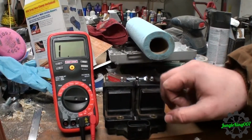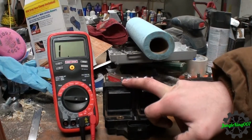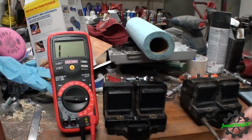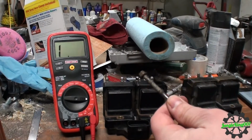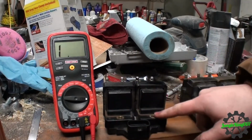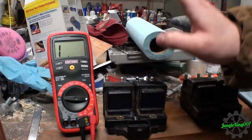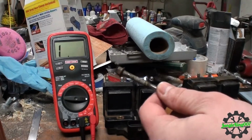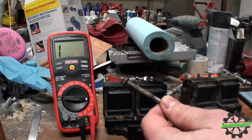The issue still remains. It is still 1 and 4 that are misfiring. I believe that's, if I'm looking at the order right, it's 1 and 4. So I'm going to clean these up. I'm going to add some dielectric grease to those. I'm also going to clean these off. And then we're going to just go ahead and, this is the original, I'm going to put this back on, see if maybe it was just simply these were too corroded and not giving a good ground.